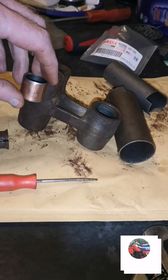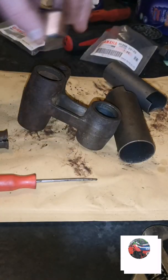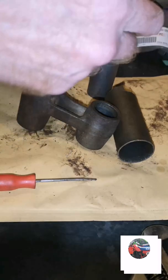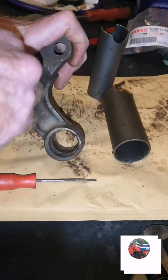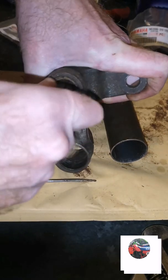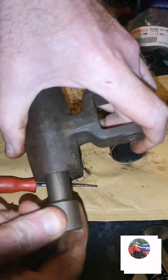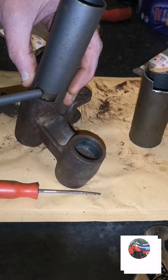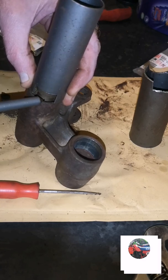That's the brass clip what's in, there's two of them, and there's two in this swing arm as well, so we'll get this brass clip out now. So just get the same pull as what I pulled the last bearing out with. It's the same size, it grips, it goes in, it grips in the middle. That's it. Just get in and you feel that it's gripped. Now get this in. That one will work because the diameter of the copper sleeve is smaller than this. So this will just slide up.